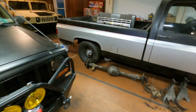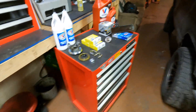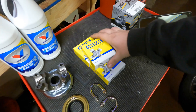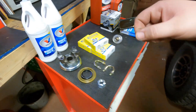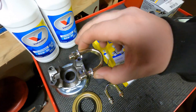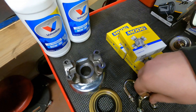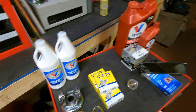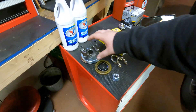Last video we swapped the rear end for the eight-and-a-quarter that's in it now. All that remains is some driveline vibrations and binding noises. We got new u-joints for all the drive shafts. When I was putting the front drive shaft back in after the transmission swap, the strap bolts actually broke off inside the yoke, so I got a new yoke - a u-bolt style, which is a lot stronger. Also got new diff fluid for the front, doing an oil change, a couple interior things, and a new thermostat because I don't have heat.